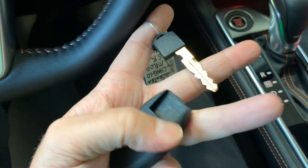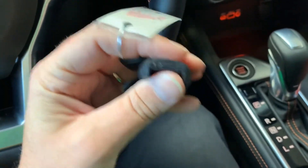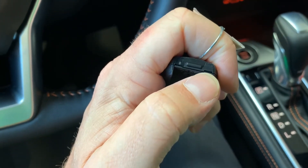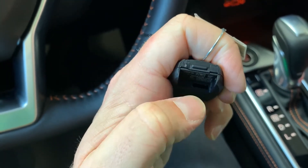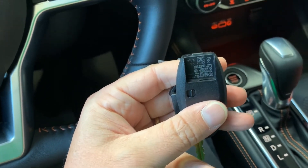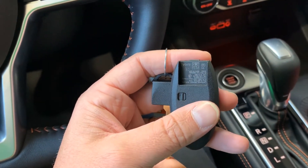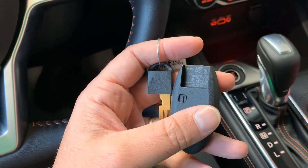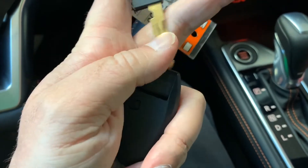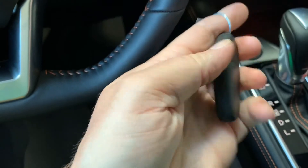From there it's time to get a new battery. You can go to the Nissan dealership where they'll do everything for you, or change it yourself. Simply put something into one of the two recessed areas and give it a little twist to pop it open. The battery looks like a watch battery, just a little bit bigger — the number on the battery is your battery size. Do not buy dollar store batteries — they typically only last three or four months. Pay the six or seven dollars to get a good battery; it will last another two to four years. Pop the battery in, close the case back up, put your key back in place and you're good to go.